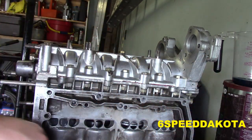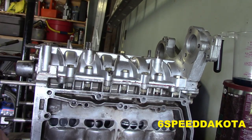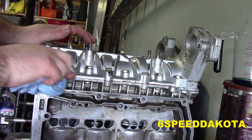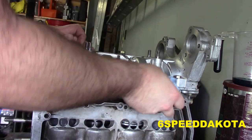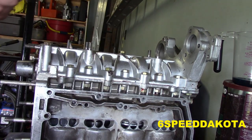That's it, that's all. Now, we're just gonna put our side port covers on once I clean all the oil and crap out of here from me oiling the hell out of everything. If we have any anaerobic gel, all we do is we just wipe it off. When this stuff squishes, you should see a little squeeze, but it won't cure in the air.